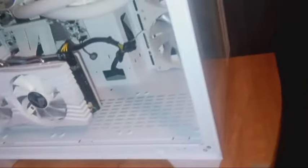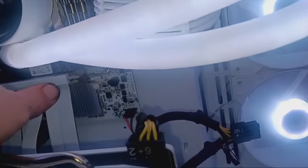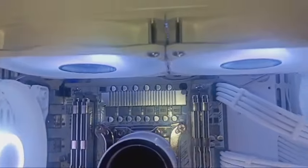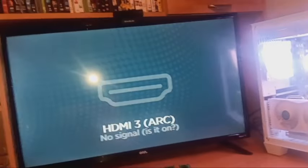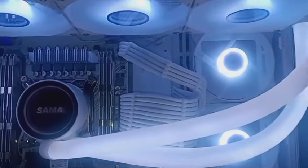Looking at what she looks like - alright, checking: are the cables seated? RAM slots are closed. We've got the fans spinning. But it's not outputting video. The speaker is not beeping, so it shouldn't be a RAM error. I've got to figure out why it's not outputting video. But man, that looks so awesome - the white really does it a lot of justice, I really like the all-white.